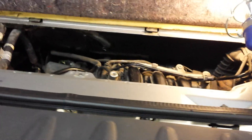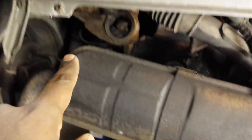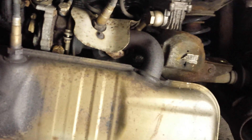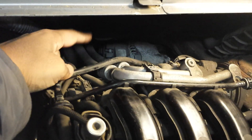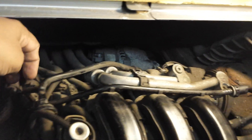I was covering notes about the lowering of the engine. I've removed these two bolts from the engine mount on the right-hand side at the back, and the engine mount is now lowered, whereas the other engine mount is still connected to the chassis. There's also an engine mount at the front. By removing just one engine mount, the engine is quite lowered and I've got about seven to eight inches of space to work on the starter motor.